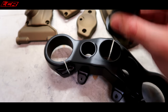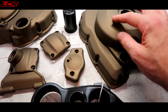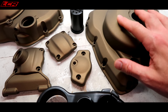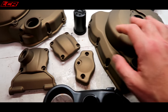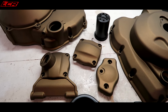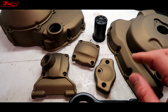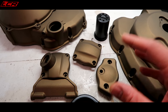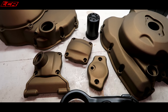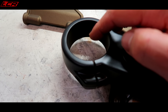A lot of people are asking questions about Cerakote and how it differs from powder coat. The main difference is that Cerakote is a very thin coating - it's like a chemical process, whereas powder coat is applied as a powdered paint that melts and coats the item. Cerakote is tougher than powder coat. You can also apply it to plastic, whereas powder coat uses magnetised particles so you can only spray metal items. With Cerakote you can do plastic parts, even wood.